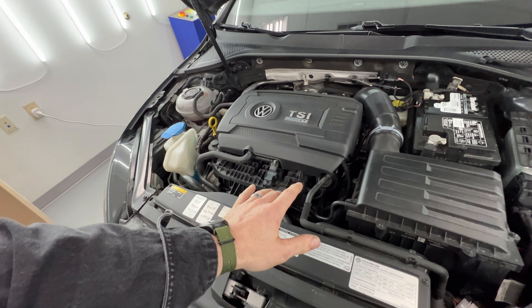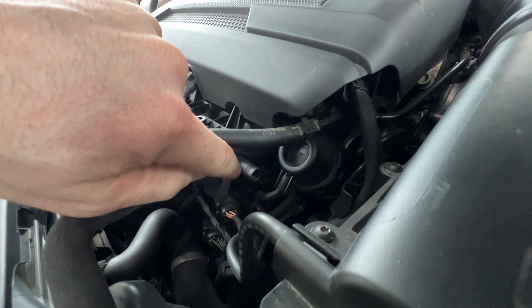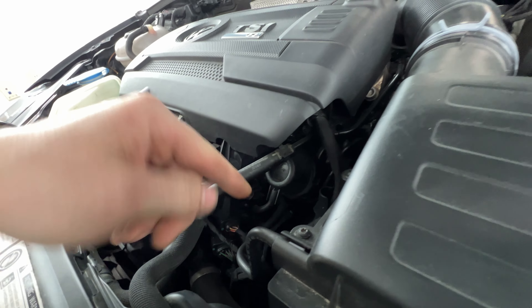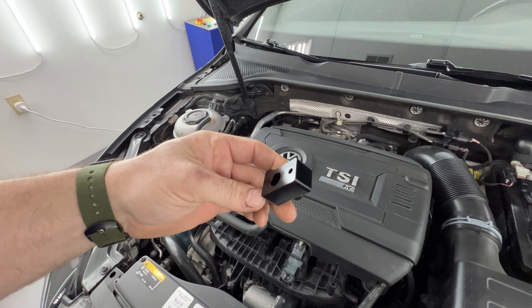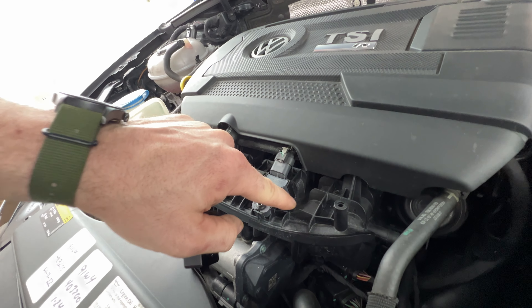Now on this engine there are two main styles. One requires you to punch out this unused port on the side of your intake, and now you have a hole in your intake with an adapter that runs tubing up into your dash for your gauge system. We offer a style which is an aluminum block that sandwiches in between the map sensor and the intake manifold. Like everything, there are pluses and minuses to that setup.